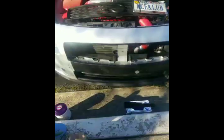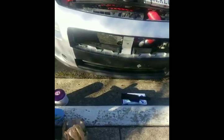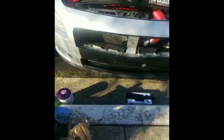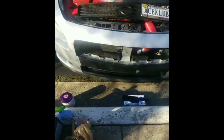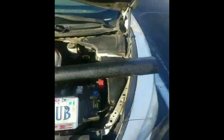That was just to get the bumper off. I want my carbon fiber vinyl to go below the grill, down here where I already have painted black. I've already treated the bumper by cleaning it, claying it, and using an alcohol-water solution — 50-50 — sprayed it down, wiped it down, let it dry, and now I'm adding on my vinyl.